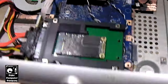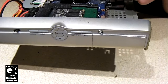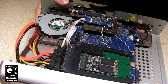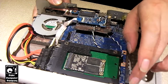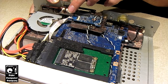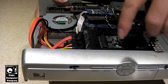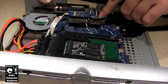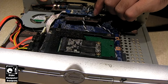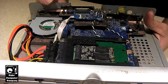Get a look at how I rigged up the power switch on this thing. On the front here we've got an LED which I just soldered into the terminals on the motherboard — there's an LED on the motherboard that would normally shine through a power LED on the laptop above the keyboard. I just soldered in a regular LED into that, in parallel with the existing LED that's still on the motherboard. And for the power button, I tore apart the little membrane pad, the little tactile switch, tore that apart and just soldered in the leads there. A little bit of redneck engineering — nothing new on this channel.